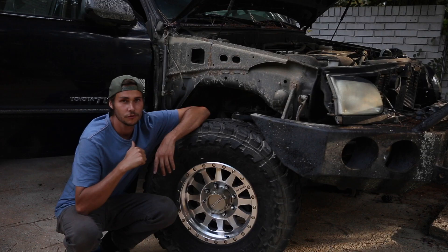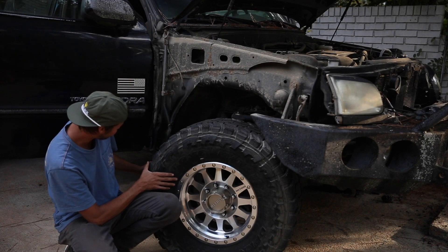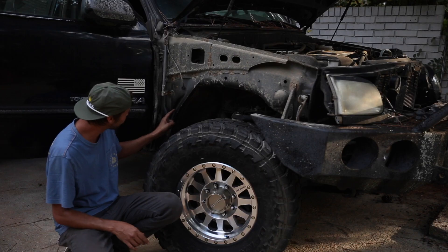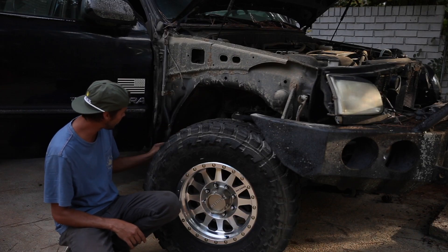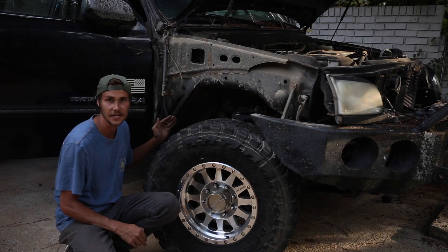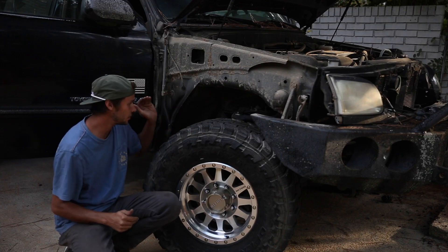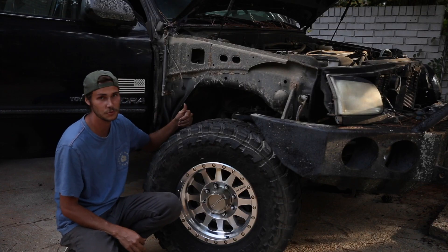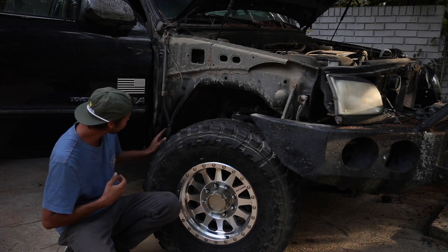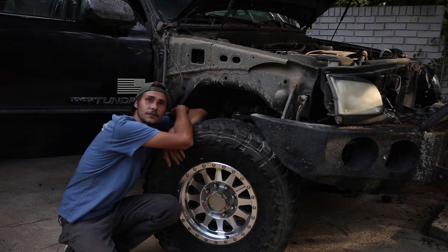The back paint is drying and we were running into some issues with the pinch weld fenders rubbing. We removed the fender and looked at what we've got — these are 35-inch tires on a two-inch lift, so there's only so many ways you can do it. We're going to cut out this pinch weld right here, go all the way back, hit this part of the firewall, and lay a flat piece of tube in there so we can hopefully clearance these tires as best as possible. The front suspension isn't going to stay forever, but we've already done so much in the rear that changing anything up front is just going to compound issues. So that being said — take the grinder, cut all this out, lay some new tube in there, and do like three more days worth of work.